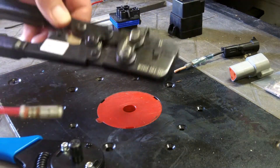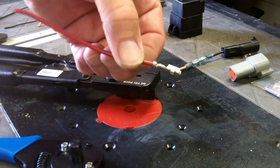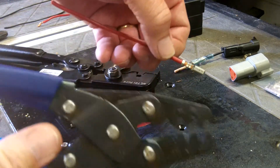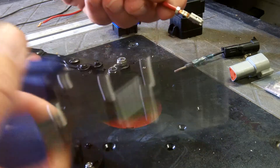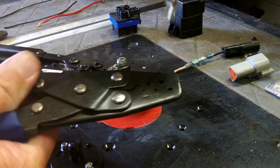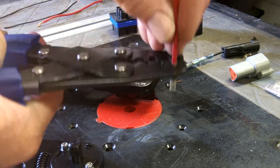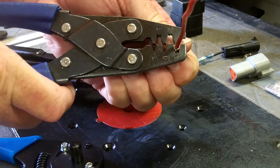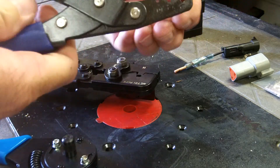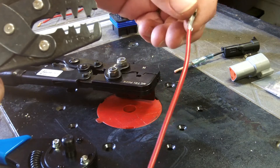Completely done. These were $200 — they're nice but I don't have a whole lot of use for them so I put them back on eBay. As you can see, it crimps both sides on the wire and the sheathing at the same time. You could do the same thing with these $8 pliers I bought off eBay — you just have to make sure you load it into the right size and that the fingers point toward the part with the double deal in there, and just crimp. Does the same thing. You can do the exact same thing on the Deutsch connectors.